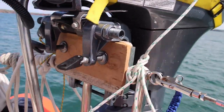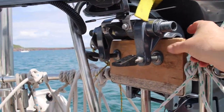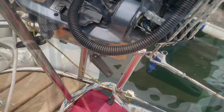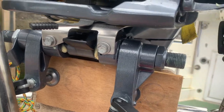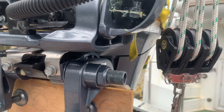The only issues we've had with it on the boat are we had to add a little spacer in here because the mount is a lot bigger than on this type of motor. There's quite a lot of grease on the system which is good. The only thing I would probably talk about is, although they showed us how to grease it, it seems as though there's a specialised grease nipple required, so we may either have to find that or come up with some alternative.